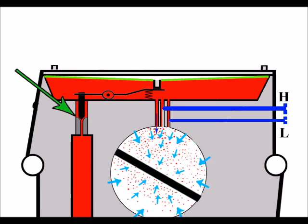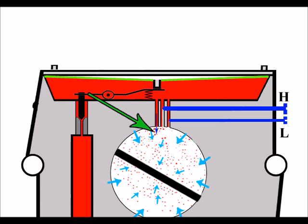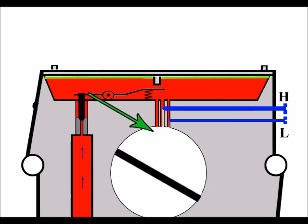We're not getting movement here on this needle valve to allow fuel to come up through and be sufficient enough to run the engine. I've just used the air and fuel in the centre of the carb there just to illustrate my next point, but in this scenario there wouldn't be that much available. But if the engine ran at all, then there might be enough for idling speed, but if you pull the trigger, this is what would happen, and open up the throttle, there'd be less and less and less. And then of course, as always, as the engine demands more fuel, bog down. And the engine's most likely to stop.